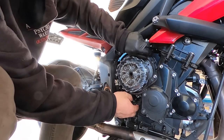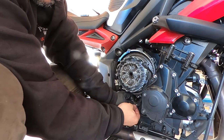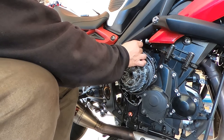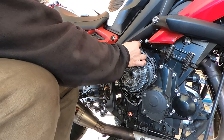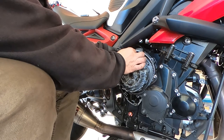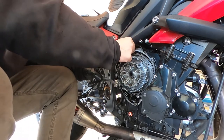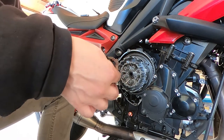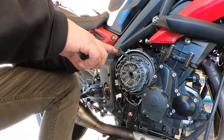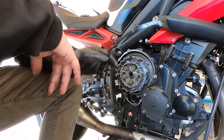Now we're going to remove the gasket from the engine case. If you're lucky, the gasket will just come off without leaving any sticky residue. But if you're like me, it's going to tear and break and leave a lot of junk around, so you'll basically need a straight razor and an X-Acto knife to clean up the edges and scrape off as much of that gasket as you can. Try not to damage the engine case because it's really soft — if you cut too far or too deep, this will cause leaks once you put the gasket back on. Take your time and make sure you're not dropping any debris inside the engine case. Also note there are two sides to this gasket: one side has writing and text on it, and the other has no graphics. The side with graphics was facing toward the engine when it came out, and I believe that material is a little softer, possibly slightly sticky, so it adheres to the engine case when tightened.